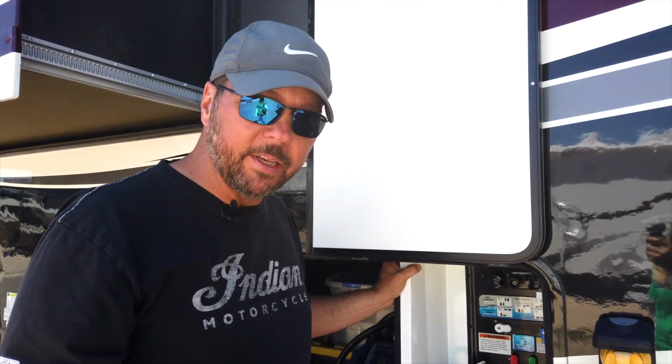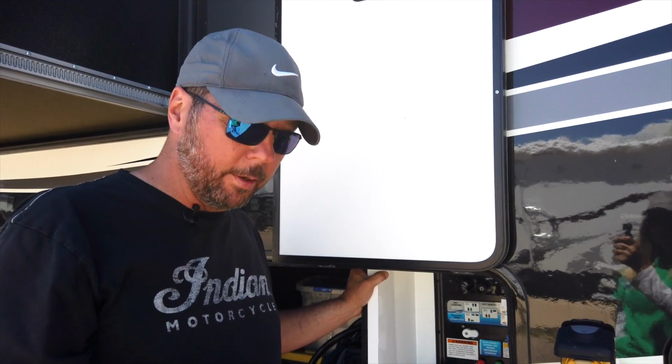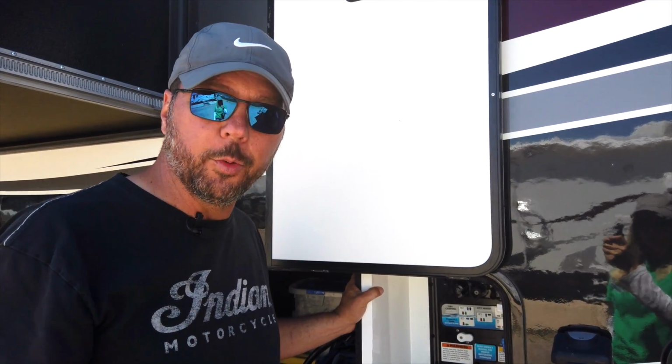Yeah. Also, you want to make sure that you use a different hose for your black tank flush than you do for your freshwater. A lot of people will have a separate colored hose. We just have the same hoses we use. I just know which ones are which.